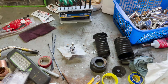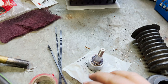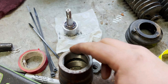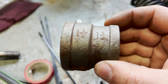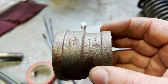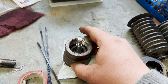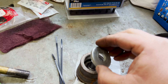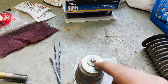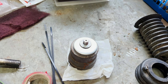Trying to be lazy here — gotta take that ball joint out and I don't really want to take the whole suspension off. So I found a inch and a half, inch and something coupling that looks like it's gonna fit over, and then we'll just washer it up, stick the nut on there on the machine, and try to pull it off. Hope for the best.